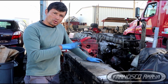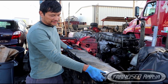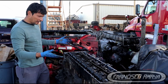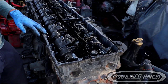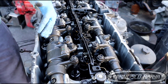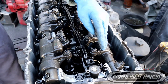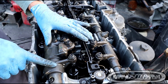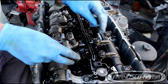Once you remove all the top components, you can easily remove the valve cover. As I can demonstrate on this engine, you remove it pretty easily, set it aside, and then you have access to the valve train. This is what pushes the valves in and out depending on the needs of the engine. We have one side that is intake and the other side that is exhaust. The difference is that we have a different adjustment for these two — make sure to follow the specifications on the valve cover.